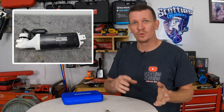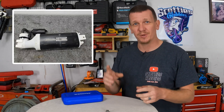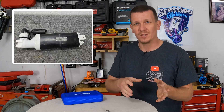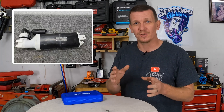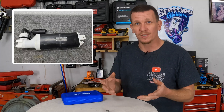Now you can see I found a picture of the 2011 to 2020-ish vapor canister and leak detection pump right here. I will circle the leak detection pump on that one. All of the Dodge Chargers from, I believe, 2006 to 2023 are all going to be in the same location — the leak detection pumps and the vapor canister. They're all going to be there, but they are going to have a little bit different look.